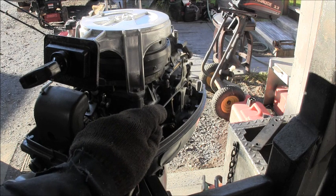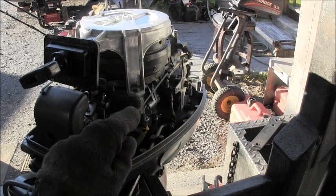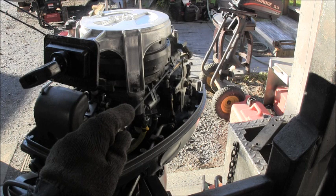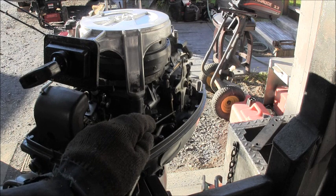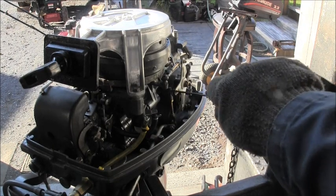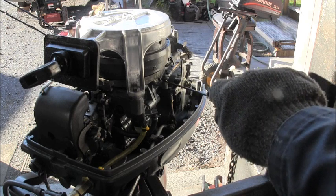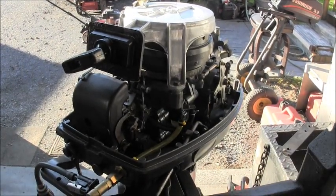And I do like the way this one is made out of brass. So are these pieces. That's brass. But these are fairly standard on many outboards and can be bought at any good marine supply or taken off the ends of cables and so forth. But this whole system doesn't look like it would be that hard to copy. And if you see, it's hooked to the mag plate here, and you could do this several ways. You could literally put a bolt and a nut and then another nylock on top and leave a little space in there. And then it comes over and operates your cam.